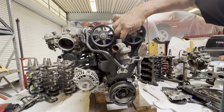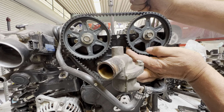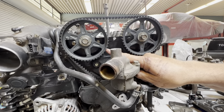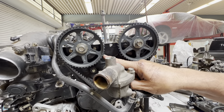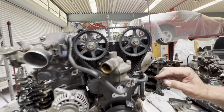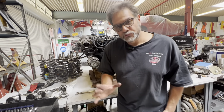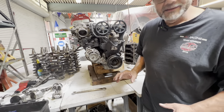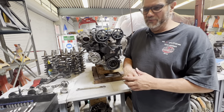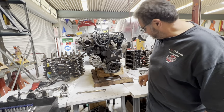I come over here to my timing marks — this is my timing mark right here with the I. I put my finger on it, slide it back, and it should line up with this mark. This one does. Then I go to this one — there's my timing mark with the E — and I follow my finger back and it lines up right there. If I went to this one it's too low, that one's too high. This one is set correctly. That's the minimum I do, trusting that the timing cover is not warped or bent — that's why I always replace it with a new one.